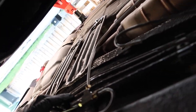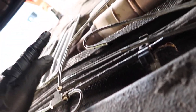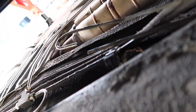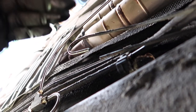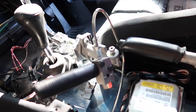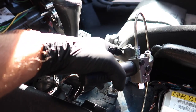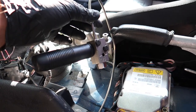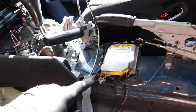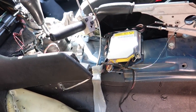So I'm gonna do this one, put the T-piece on this, run the hard line, and then tidy all this up, and then I can go up the top and flare the pipes at the top, and then install them into the cylinder on the hydro. Alrighty, now I'm just flaring my first tube. So this is gonna be the one at the front, which is the bubble flare. So gonna flare that one up now, and then gonna put the next hard line in, and by the time we come back, it should be all in.